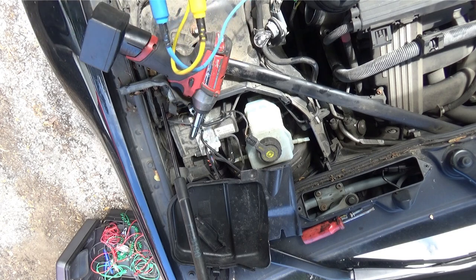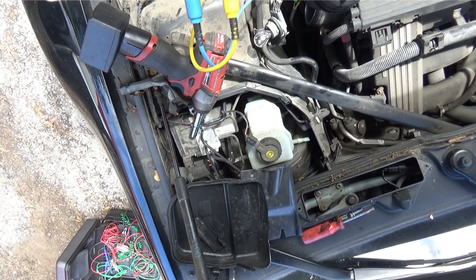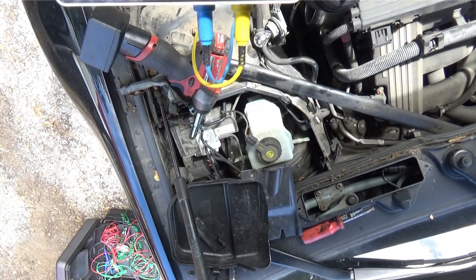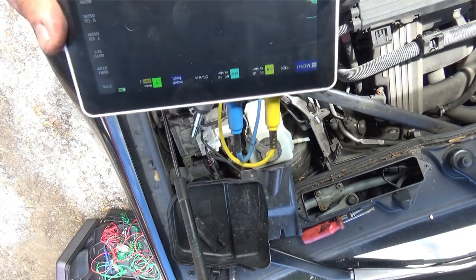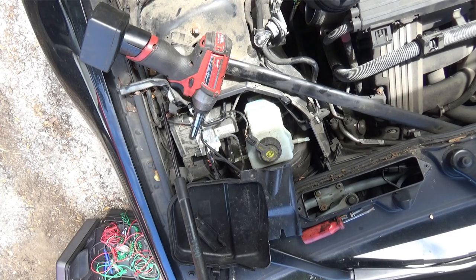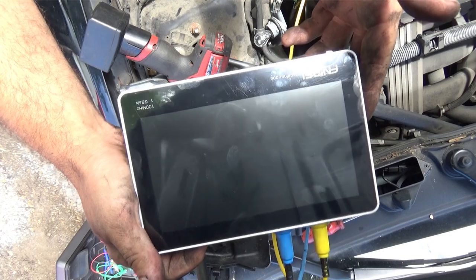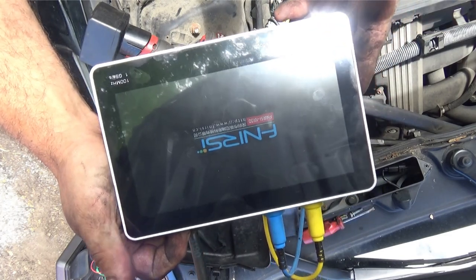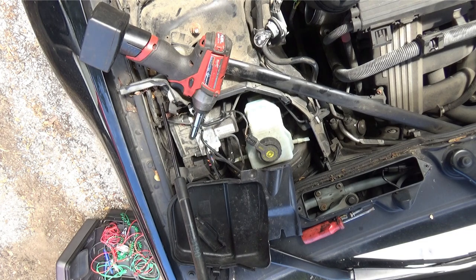That is on my power feed to the throttle body, not a signal wire. So what does that tell me? My throttle body is defective. On top of the throttle body being defective, we also have a defective pedal position sensor — we have 5 volts and ground at the APP but no signal coming out. So we need two items on this vehicle. We wouldn't want to just change the throttle body and miss the APP sensor. Throttle body and APP sensor — that's the diagnosis. I'll bring you guys back once I get the parts in. Great little oscilloscope tool — powers up and down super quick. Hope you guys enjoyed this video, see you next time.